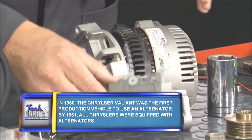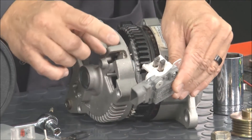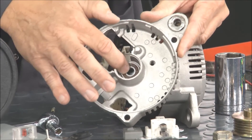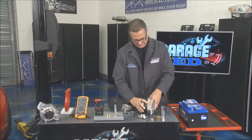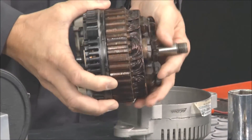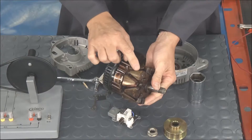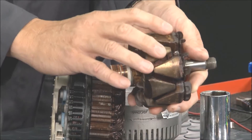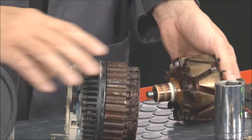I want to pull one apart and show you everything going on inside. I took off the voltage regulator right here — these are the brushes that supply power to the actual rotor assembly. Here's my end frame with some bushings inside. We'll do some diagnosis in the next show. Separating this, you can see the front quarter, and right here is the heart of the alternator — the rotor assembly. The rotor assembly has these claw poles all around it and a big wire winding in there that I'm going to magnetize in a moment.